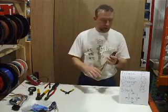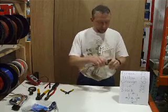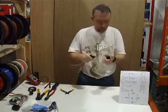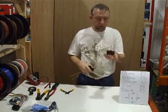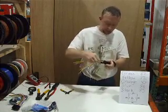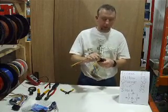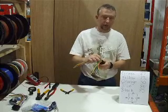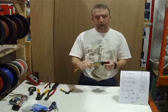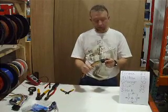But anyway, we're going to do it on the budget. This here is two standard single-pole double-throw relays — they have five pins on the bottom, like most. These are just Omega 5-wire sockets. Now, in some cars the one-wire system is a negative type and there are also some that are positive type. I'm going to show you the negative and then after I'm done I'm going to show you quickly how to also apply the same job just using positive locks.